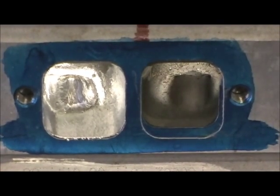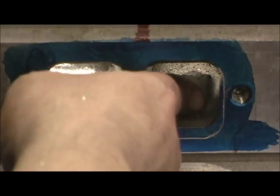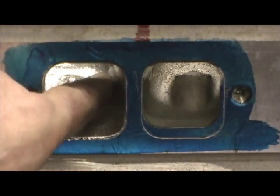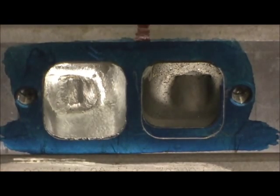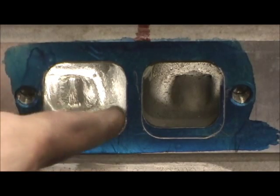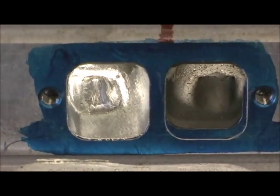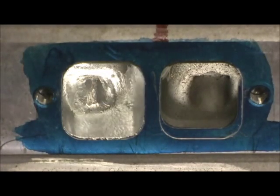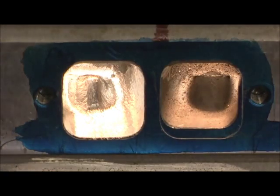Now look what a difference it makes. This was really flat as it hit the guide. Now she's got a layer in where I dug in on the side — it's got a turn, it's got a gradual degree upward lift. So the hot air gas just ain't coming in and hitting and banking off. That alone is worth quite a few numbers. We won't go into raw size. I know it's shiny — I'm trying to close off some of the light. I know that on camera, looking through the lens and looking at it once it's done is different.